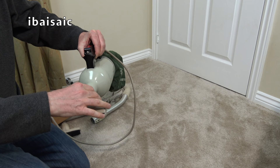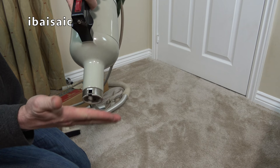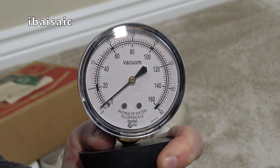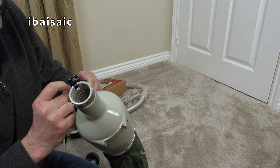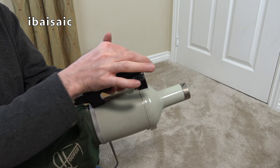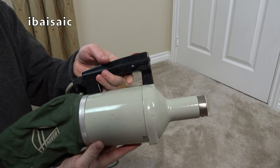I'm going to get my suction gauge actually. It's not going to measure much - we might not get an accurate reading because when you take a nozzle out we're left with a big hole here. So I'll have to put my finger over it and we'll just see. I think it'll be under 10 on my suction gauge. Well that wasn't a bad guess - it was just under 10. And then while I was doing that I've noticed there's a little bit of damage just to the top of the handle cover. But I'm sure somewhere in my stash I've got another of these - maybe not this colour, but if the handle top is fine on that I'll just swap it over. The condition of this one - yeah it's got a few sort of scuffs but they're just dirt, no damage. That's in lovely condition.